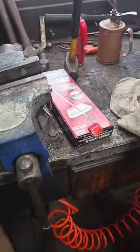All right, so put Loctite also on these, and make sure that you also have your lock washer in addition to everything. But yeah, use a little bit of Loctite. I'm just going to go by feel more than anything. Tighten it all the way down by hand as much as I could, and then I'm just going to go until it feels snug. Because obviously you can't tighten these down too much. Apparently, you'd end up crushing the U-joint.